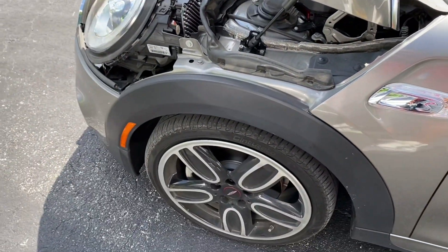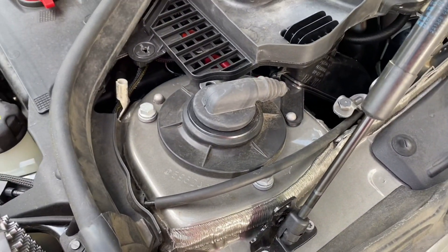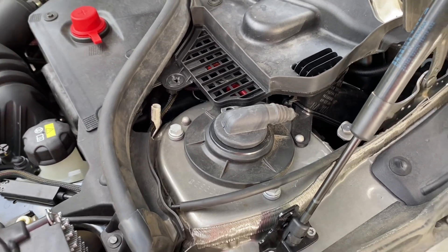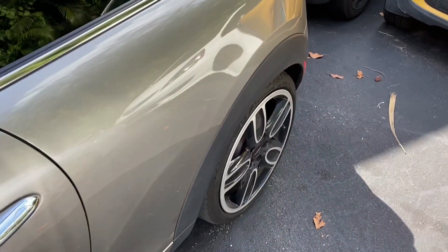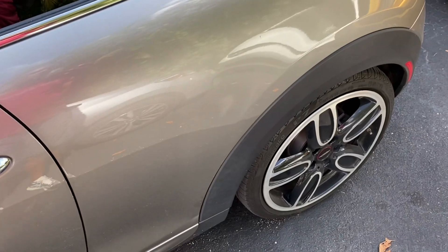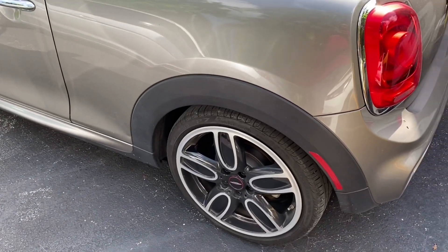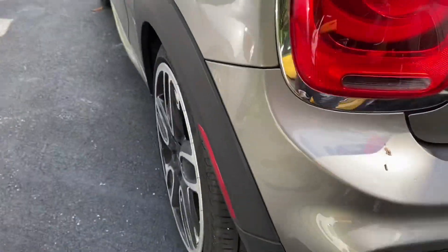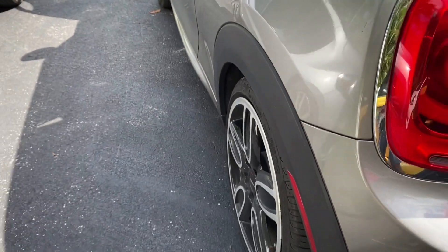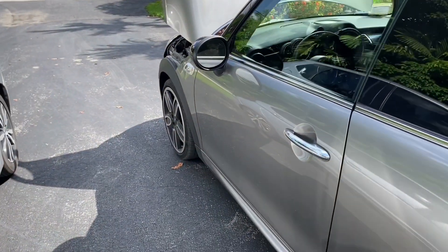This car - you can see the top of the strut tower in the front has a cable coming out of it, which means it has a dynamic suspension. That's something that to me is a little valuable and I'd like to keep it, so it's enjoyable to drive the car and swap the feel. We opted to go for some NM Engineering springs, and we also got some spacers to bring these wheels out a little bit - 15 millimeter in the back and 10 millimeter for the front.